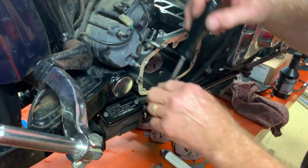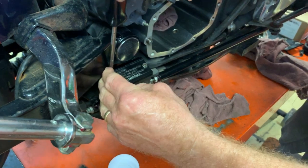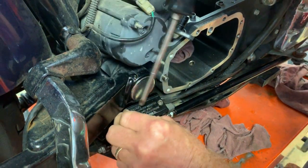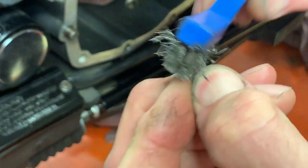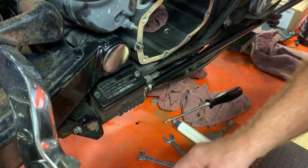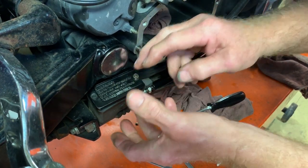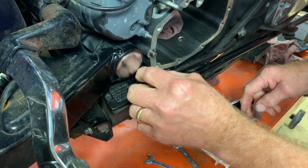Now I've got this out and it's nice because I've got the exhaust system out of the way. These two screws take a Phillips screwdriver to remove. When you take these screws out, clean them — the threads get all corrosion in them. Clean it and put just a dab of three-in-one oil, something to keep it lubricated. Because if those two screws get really, really rusted, you're going to break them off, and then this whole unit needs to be replaced. So doing a little lubing always helps out.